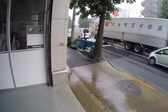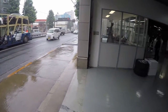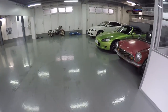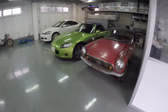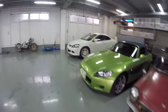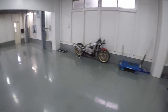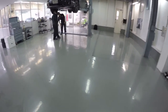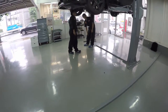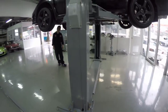If you don't know about Spoon, it's a tuning company that's famous for tuning Honda cars. Basically, I have my car here today to add a little performance part — the rigid collar. It's an aluminum collar that I'll be adding to the car, which will allow the subframe to be snugly bolted onto the mainframe.